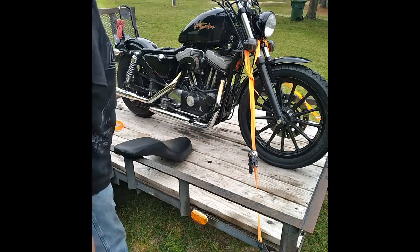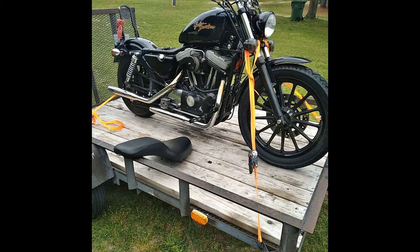I hate the barrel key. Tested it last night — as far as battery goes, battery's fine. I had bought a battery because I needed one for the other bike anyway. This is the battery that was in the other bike — the salvage bike — because the battery that came with this thing was dead as a doornail. It won't even charge, and as soon as you put any load to it, it's like two volts. It's fried. Anyway, we swapped this battery out with the other bike, and battery's fine.